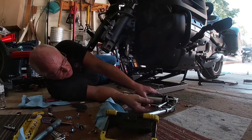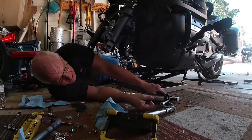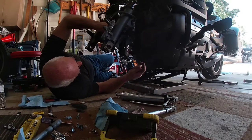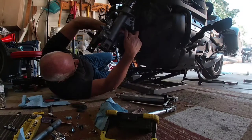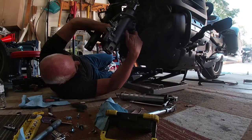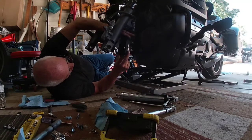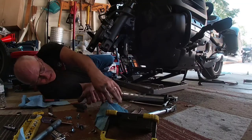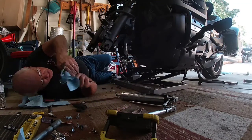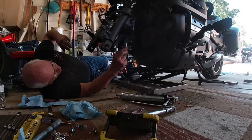Just while I'm in here, might as well. Put a little dab of grease on there — it's gonna make it slide a little bit. Now see them? That shows somebody that your caliper slides — the whole thing moves. It's retained on there, but the whole thing moves. Something to remember. These are all good and flush.